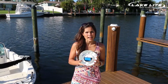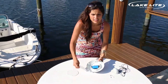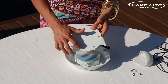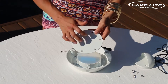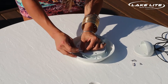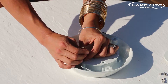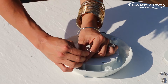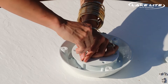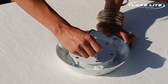Now that you've connected your battery and tucked the wire inside, it's time to replace the cover. You'll start with the silicone pad and align it over the screw holes. Next, you'll take the metal plate and you'll notice some beveled edges — those edges face upward — and align it over the screw holes. Once your cover is in place, it's time to put your screws in. It's important to go in reverse order first until you hear a pop to help catch the threads. Put all screws in before tightening down, then work your way around to tighten them all.